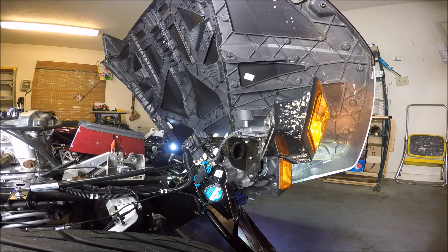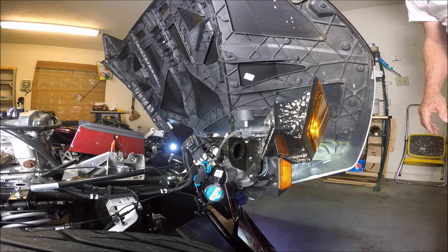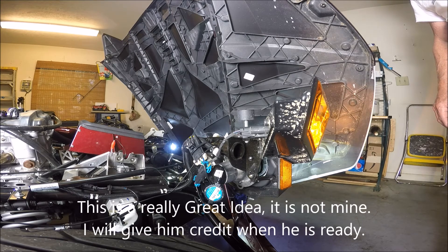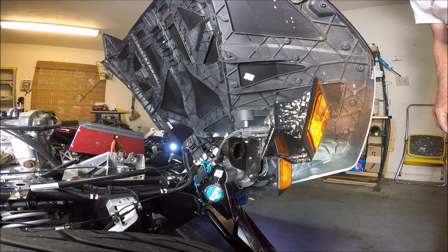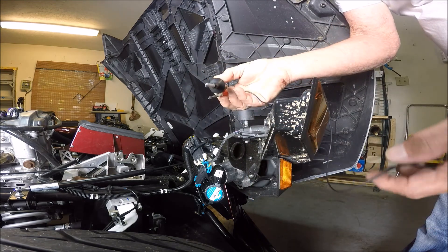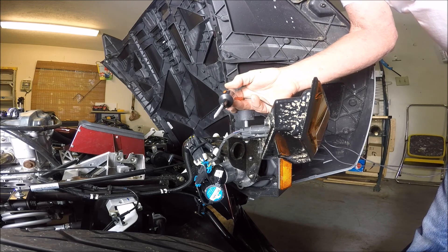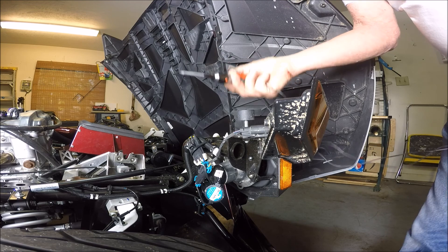The biggest thing is running your wires around and finding a good place to connect to that pin number one wire. Good luck on your project — it sounds real good. I may look into adding this myself; it'd be nice to have an indicator on the rearview mirror so none of us will be driving around with our left blinker going. Make sure you get an LED-type test light and not a conventional high-drain test light — that's safe to use on the Slingshot.